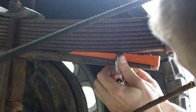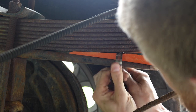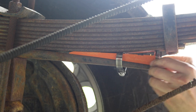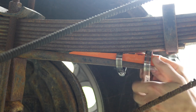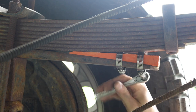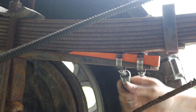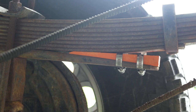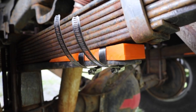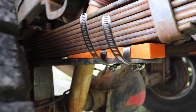I got the truck jacked up from the frame — not fully in the air, just enough to relieve the pressure the camper is putting on the springs. They need to go in that groove right there, then I pull the hose clamp around. Line it up, slide the second one in the same way, gotta find that groove. Going equal — a little bit here, a little bit there — and we'll see if the hose clamps keep the springs from spitting these wedges out.